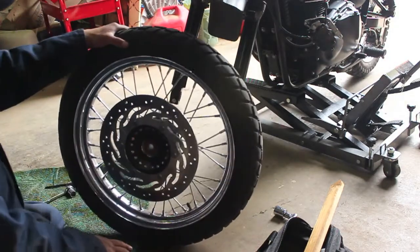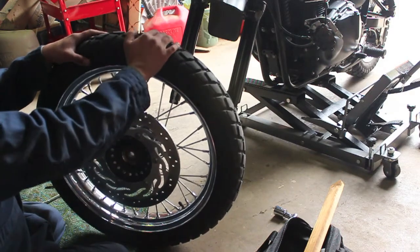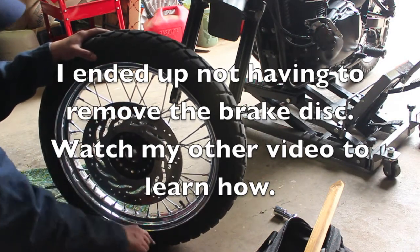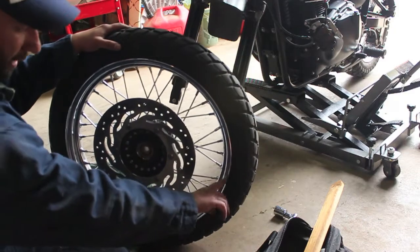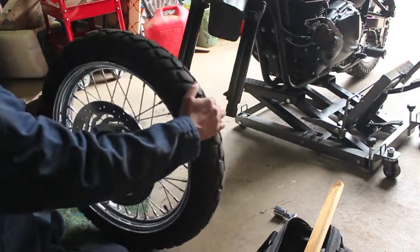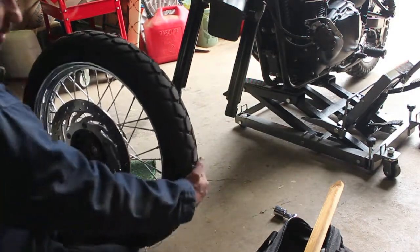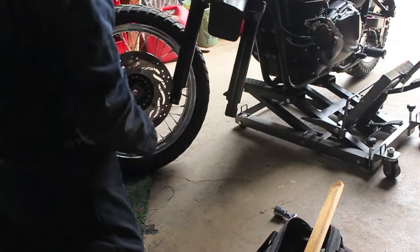What I'm going to do is paint these rims satin flat black. But in order to do that I have to take the tire off, take off the brake disc, and then unscrew all of the spokes - just to be able to paint this solid. I want to keep the spokes chrome and the rim black, and it's going to look really nice. My hubs are already black so that's cool. Now I just need to take this to the tire guys and have them remove the tire for me. Remember, don't lay the tire down on the disc side - instead get a couple of blocks, one on each side, and let it hover above so that you don't warp the disc in any way. That's it for the front tire.